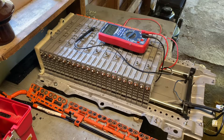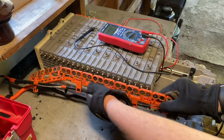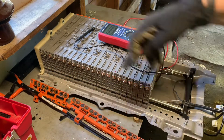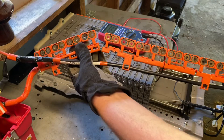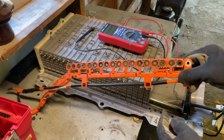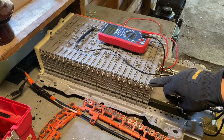Once you've got your battery pack out, you'll immediately want to — wearing gloves of course — take one side of these joiners off, because when this is on it stacks all the voltages up and it's around 200 volts. Now when you pull the disconnect plug out of the car, all it does is break it here, but you still have all of these together which is about 100 volts, so if you happen to touch this loose wire and the terminal, or between here and here, you will get a shock.